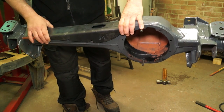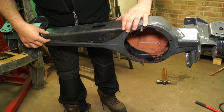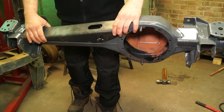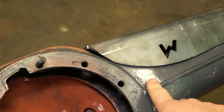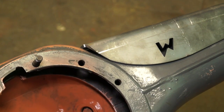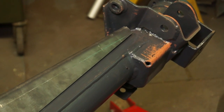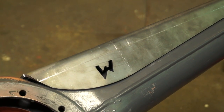After a little bit of spreading it will fit much better. You want to line it up with the top of the diff case. Fitted in the right place you'll see there is a gap, however this edge here fits on the axle nicely all the way down and this is the area we're going to weld. We don't have to weld near the suspension hanging parts, but at the end there's a gap we'll have to find a way around.